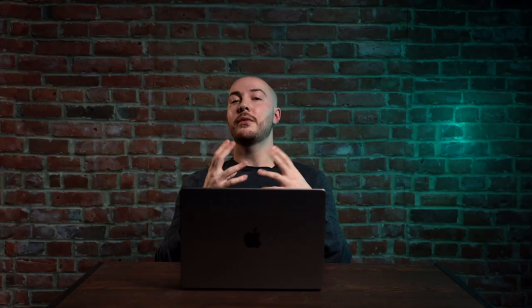Then we have hydraulic suspension, which is usually found on more expensive scooters. There are two types. The first type is a fully enclosed barrel — like the one we showed in the Pro video for the V1, V2, and V3 — with no adjustment dial. It comes pre-adjusted, which is great because it limits the amount of leaking. With hydraulic suspension, adjustment points can be a source of leaking since oil is extremely thin, requiring excellent bushings and seals to contain it, especially given the high forces exerted when you jump on the scooter.